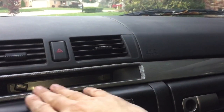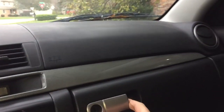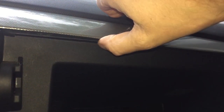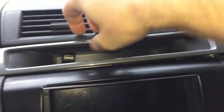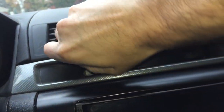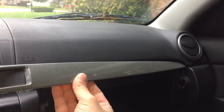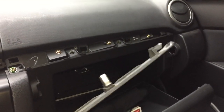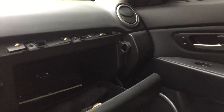We start by removing this plastic cover — the bezel on top — where the screws are for the radio. Open the glove box. You don't need any tools; just pop off this plastic piece. You can use a screwdriver if you have trouble getting behind there, but just pull out the plastic clips that hold it on. On the left side and center it's clips, but on the right side there's actually a hook, so be really careful not to break that off.